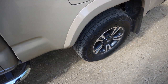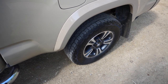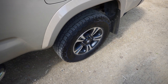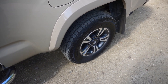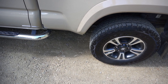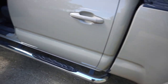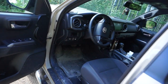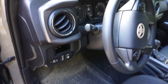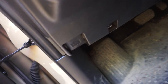So what that button allows you to do is reset the PSI sensor so that if you're running higher or lower pressures — say you set your tire pressure to 15 PSI to go over sand on a beach — you can set that lower pressure and then reset that light so your dash isn't screaming at you saying you have low tire pressure. That's a really cool feature a lot of people miss.